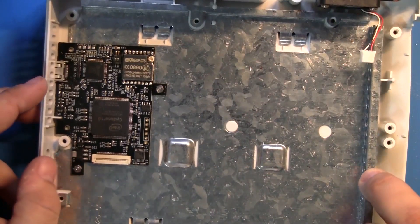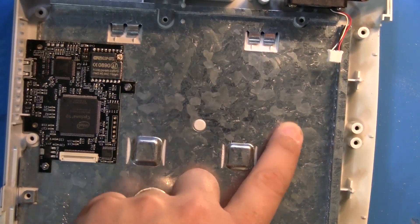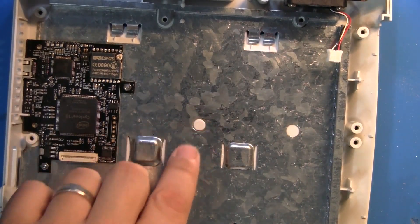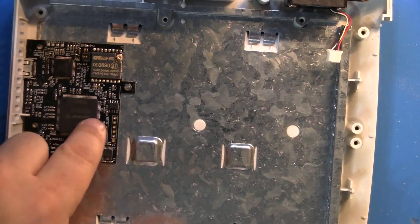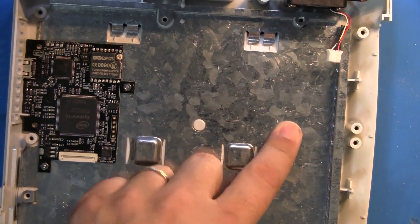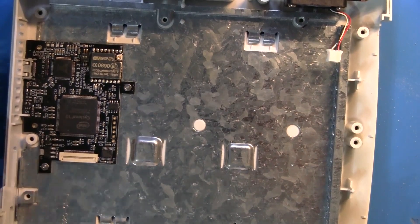If you are going to do that, there is switch number one right here on this little DIP switch — you're going to flick that on. By default it's off. We don't have any of those in our case so we're going to leave them both off. This top DIP switch right here is actually for if this unit gets bricked — you can reflash the ESP with an RX-TX programmer. This switch puts it in programming mode, so we'll leave that off as well. Next step is the flex cable. Not all cases look the same — you see right here there's a little nub, and some cases have a nub here and a nub here. If there is a nub underneath, you need to chop that off with side cutters, because otherwise it'll have a little bit of a push-up. This case doesn't have it, but I've seen a lot of cases that do, so if it does, make sure to remove that nub.